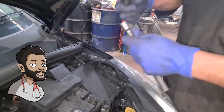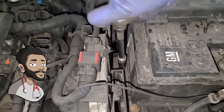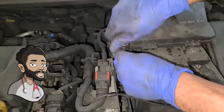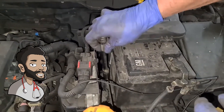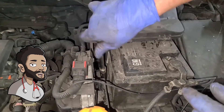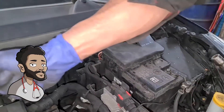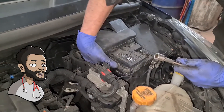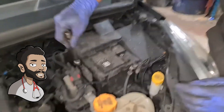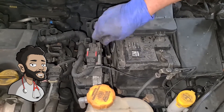But if you've got a ratchet, it's easy — you can get it done as quickly as possible. Now I know some of these screws, because where it's in the plastic grommet underneath the battery tray, if they're tight they would just spin and won't open. If that's the case, what you've got to do is put a flat screwdriver into the gap there and then push the bracket backwards and force the battery out. Once you've taken the battery out you can then try to undo that while there's no battery situated. But I've got the bracket out now.